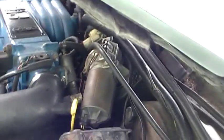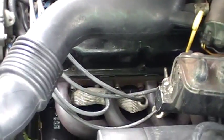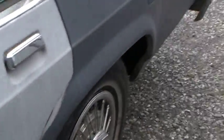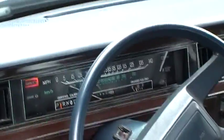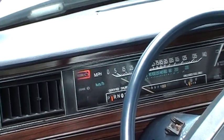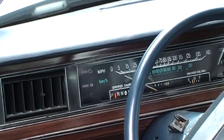See how the hood's dancing around? See how it doesn't dance around when all the cylinders are going? It's almost done — it's got about four more cylinders or so. Actually, it's done. It's displaying the code — that's code 90, which is what you want to see. With a long pause, that code is done.